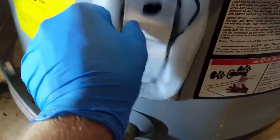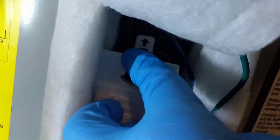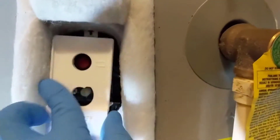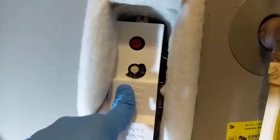Got the wires back on both elements. These covers just push on — line up where the thermostat is and push them on; usually they'll click like that. Bottom one done, now the top one. There's a little bent part but the tab needs to go on there — this one didn't click but it's on. Go ahead and put the insulation down and fold your wires back over.